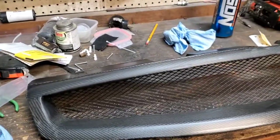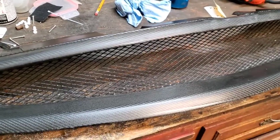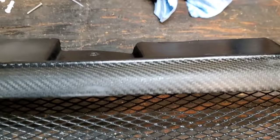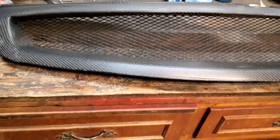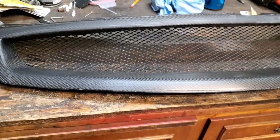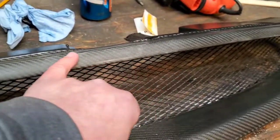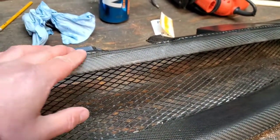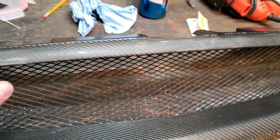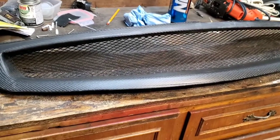Alright guys, I went over it with the towel really quick and it is starting to dry. I'm going to let it finish its process of drying. As you can see, it's starting to kind of get a hazy look to it — that's what you want. So don't be worried when you start to see that; it's going to have a nice foggy look to it, and then we'll re-spray it. I got most of that out — again, it's down in the resin, so I don't want to go too much deeper than that. It's actually coming out halfway okay. This is my first time working with carbon fiber doing this, so I'm going to let it dry for a few.